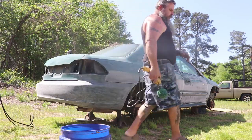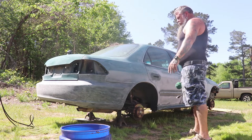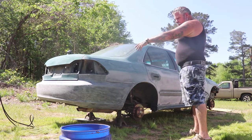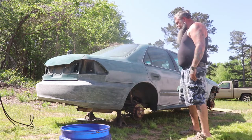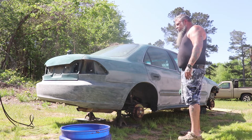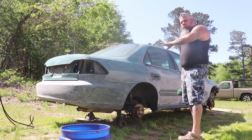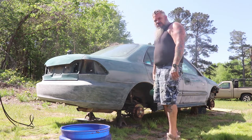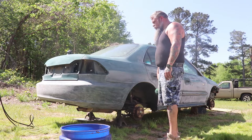Anyway, we're going to continue sanding. Today I'd like to get the whole car sanded, then spray it with the air hose and come back in with the water hose to knock all this loose dust off. Close up anywhere where it might get water in there, wash it off with a rag to get all that loose dust off. Then either this evening or tomorrow morning I'll come in and mask everything off, de-grease the whole car, and be ready to spray. This right here is a hard, boring, not-likable part of spraying a car.